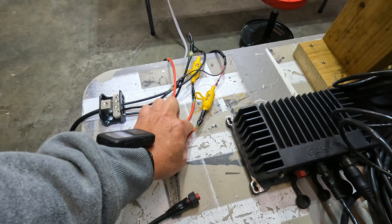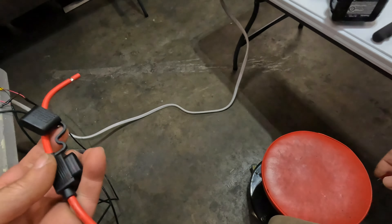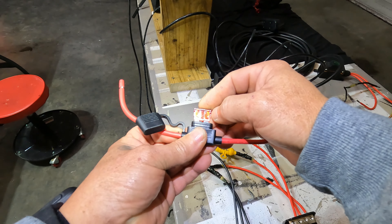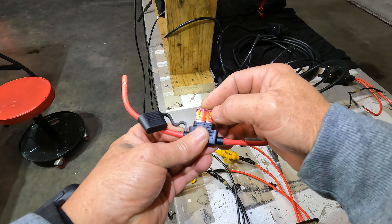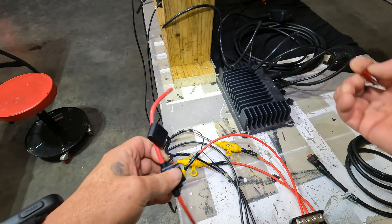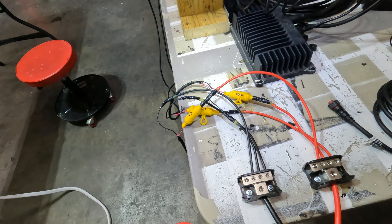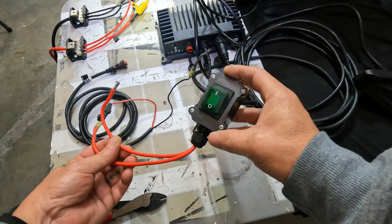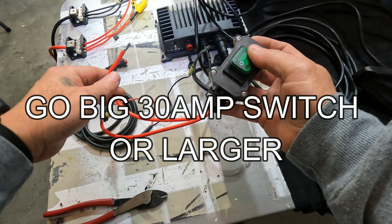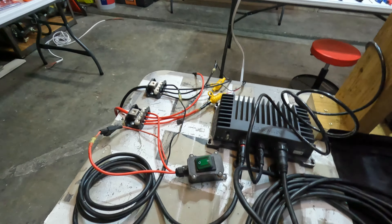You always want a 10 gauge feed going into your fuse. A little 10 gauge fuse — that fuse wire itself might actually be 20 or 22 gauge, which is way too small. So you never want to run a fuse before the original Garmin fuse; just go straight power. If you don't have a main cutoff switch, you've got to add something — 10 gauge wire.